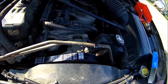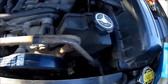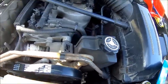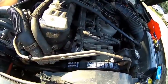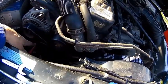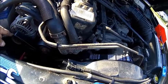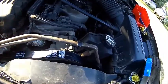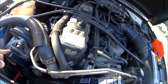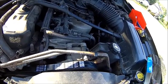Mine is a 6PK 2120, yours is gonna be longer if you've got a left and right hand drive, because there is that belt pulley down there which I deleted, so my belt goes straight down from the power steering pump down to the aircon compressor. That's the reason why I need a little bit more tension, otherwise the power steering is slipping. Yeah, if you put the belt on the bottom tensioner roll first and then just wind that in, you will not get the belt over it. My belt is relatively short, I could probably go 10 millimeters longer, but I want some clearance to the battery here, because I've got a bit bigger alternator and a bigger battery. So that's why I opted for a little bit of a shorter belt. 2130 would be fine, or 2125, something like that.